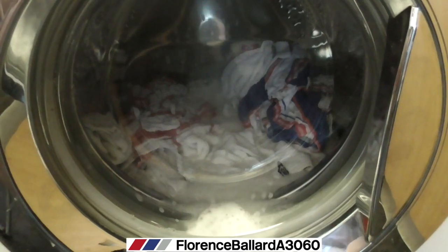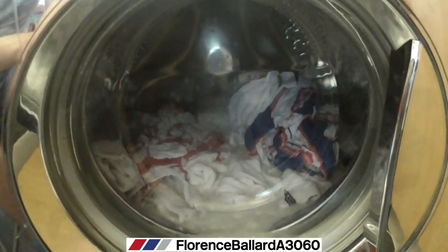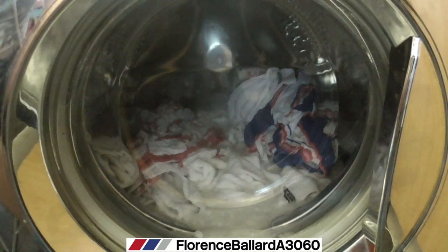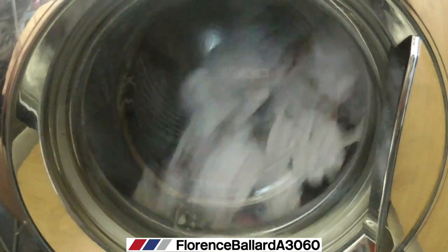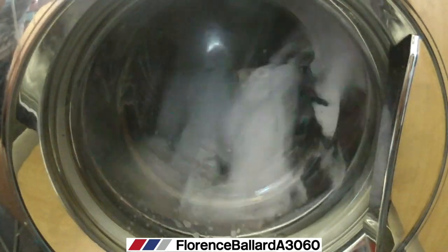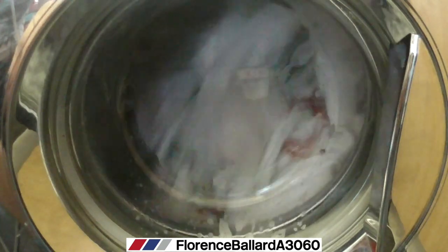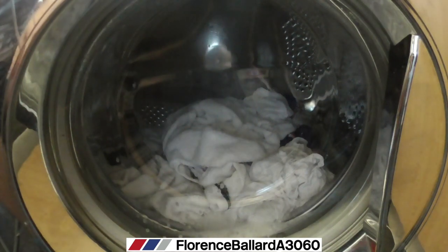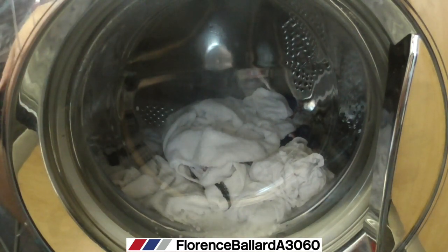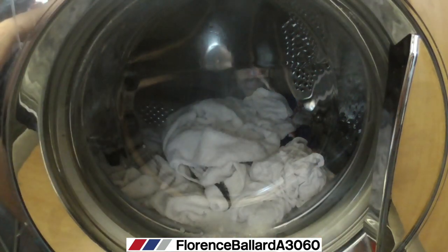We have reached 95 degrees Celsius, and I measured by checking with the machine's inbuilt NTC sensor. And we just did a filtration. So I have added a little bit more water, which the machine still heated up to full temperature. And that just allows it all to go into the door seal. That'll start hopefully cleaning out all the door seal. There is still mold up that way and it needs to go.